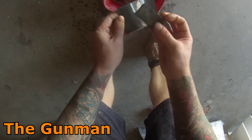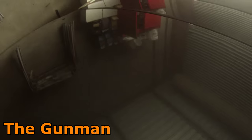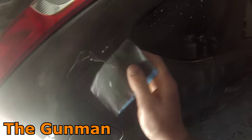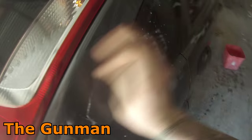It takes a couple of extra minutes on the buff to polish up the 2000 grit scratches, but it can be done. It's also a cheaper method - those 1500 grit discs are around $60-70 for a box of 50, and if you go finer to 2500 or 3500 you're looking at $130 a box. That's hard to justify if you're not doing it daily. Your preferred option might be to buy a box of 2000 grit for $40-50, a bucket, a block, and a chamois, and do it the old-fashioned way.